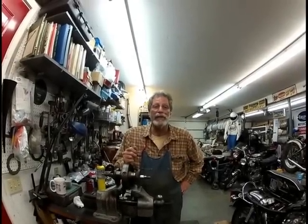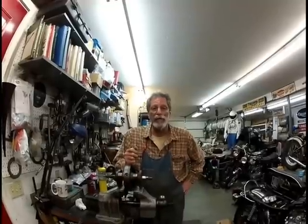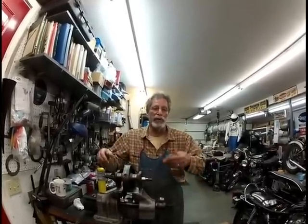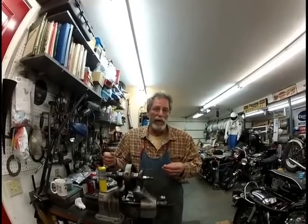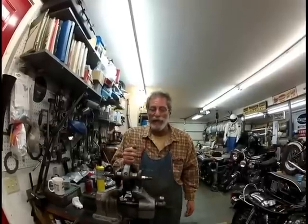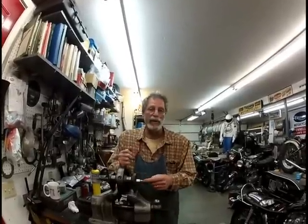Today we're going to talk about cleaning a sludge trap on a Triumph twin. BSA and Norton twins use the same technology. A sludge trap is a centrifuge which pulls sludge out of the oil, because you need some type of filtration system for your oil, and that's what they used back in the day: a centrifugal sludge trap.